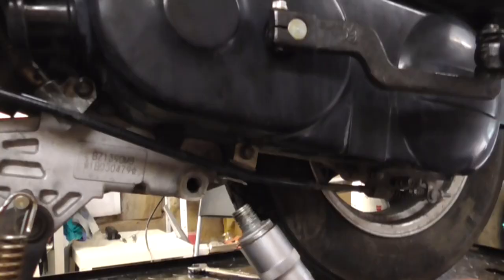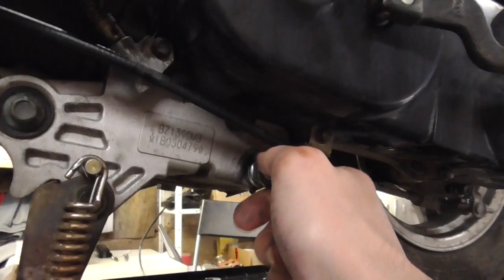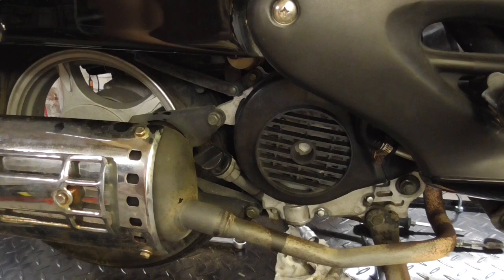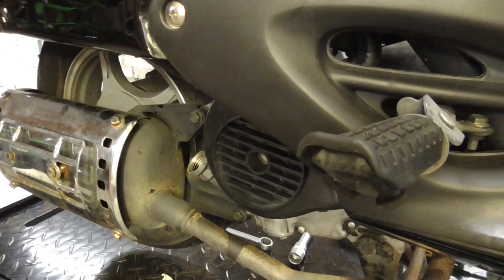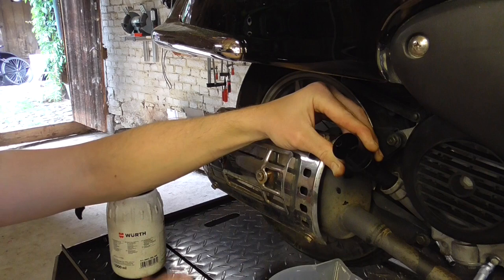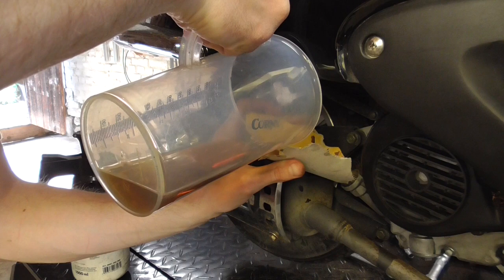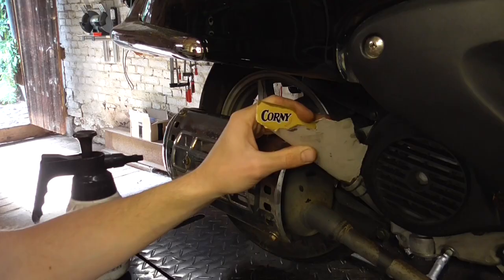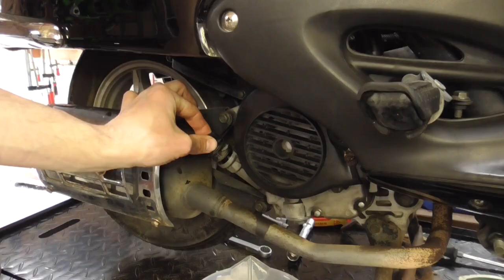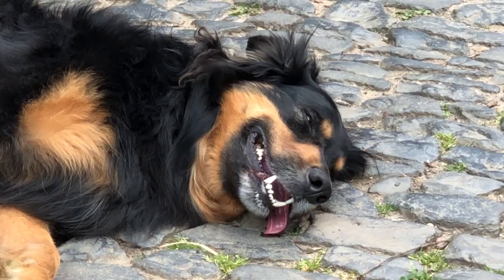The drain bolt goes back in and 650cc of fresh oil goes in — maybe using the funnel. This is such a dumb place for the oil filler — why would you design it there? Now we let it run and then check the level. It's right in the middle — that's good. I hope you enjoyed the video. Subscribe to see how we make it faster in the next part.